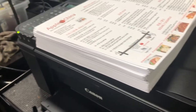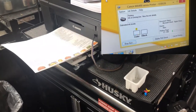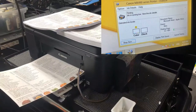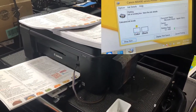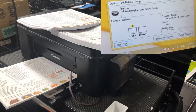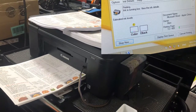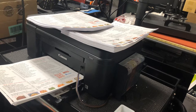Now check the ink level at the external tank — this is how much ink was used to print that stack of paper. Now we try to run the color cartridge down. You can see from the window that the black is greyed out, meaning the monitor is turned off. The color still has a yellow exclamation mark on top, meaning it's still showing low ink.